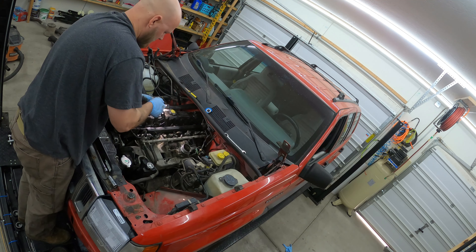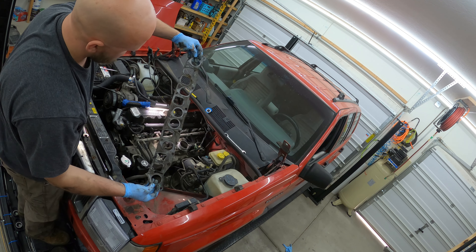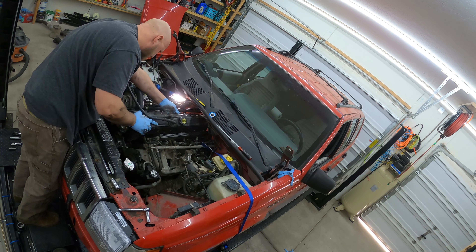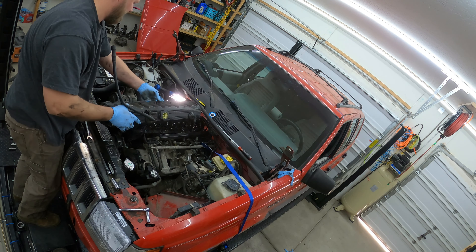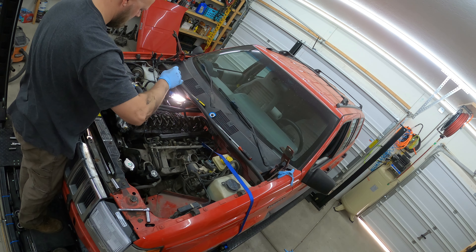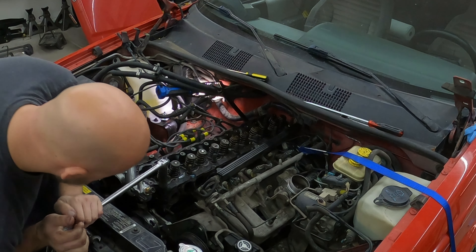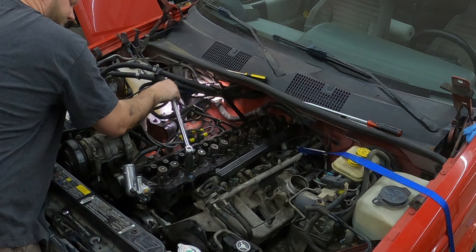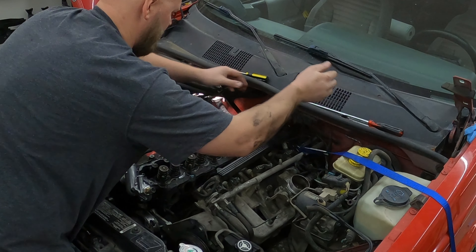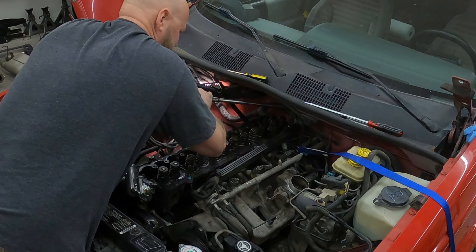Once you get that done, find all the bolts holding your intake and exhaust manifolds to the block and pull the gasket out. Crossing my fingers, hoping we can get this cover off — and it came off really easy, actually. We kind of rolled it over in place and then pulled it out. Now you're going to take your gasket off of there and clean all this up later. These bolts are in there super tight; I used a two-foot breaker bar to help break these loose, and it was a struggle for sure.